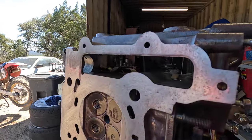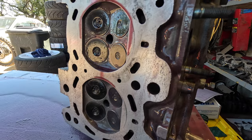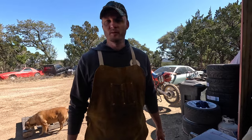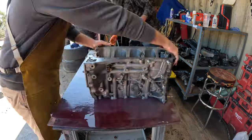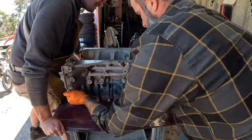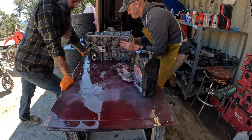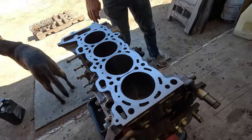After several passes with 80 and then several passes with 120, we do have a little bit of staining here, but overall everything's nice and scuffed between each cylinder. Good enough for what we're doing. We're using the OEM graphite gasket, which fills a lot of imperfections. So I think that's going to work pretty good. Got the head done, moving over to the block.